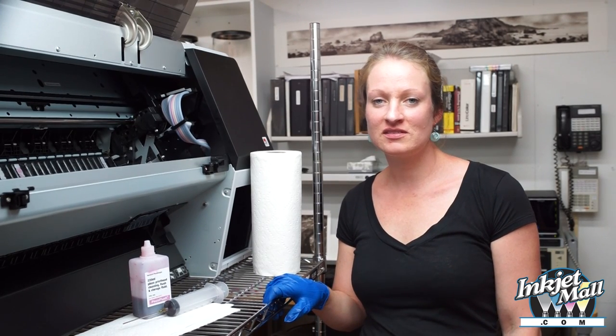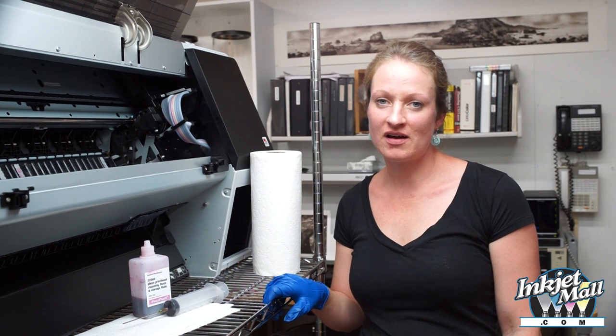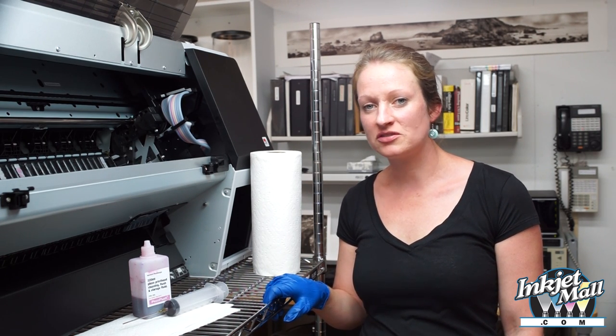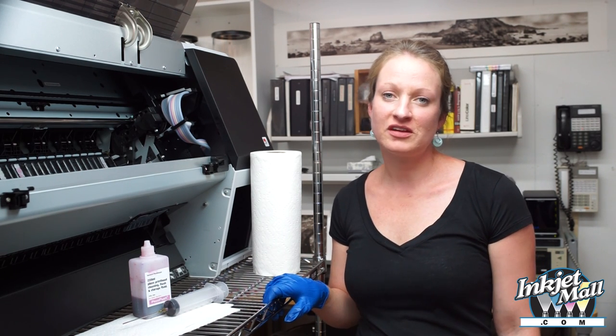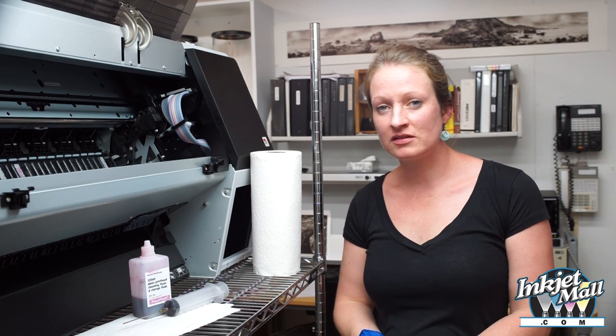If you still have stubborn clog nozzles or misfiring nozzles, another thing that you could try is installing a set of piezo flush cartridges and running an initial fill cycle to purge the ink system and allow the piezo flush to clean. A lot of times we have actually brought back clogged printhead channels that way. Make sure to reference our video on how to run an initial fill and flush your printer.